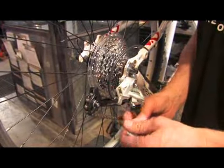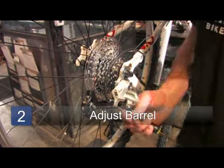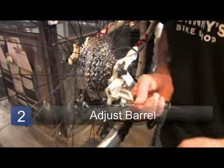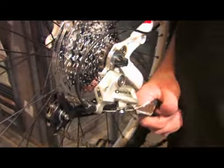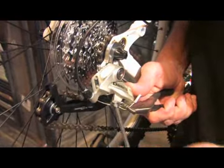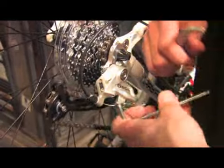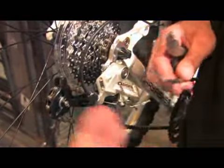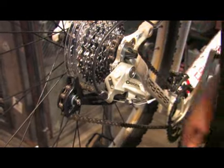Usually, if you start out by loosening the cable, adjust your barrel until you see just a little bit of that barrel right there. You can grab the pliers to get enough force on this cable — you'll want to pull this tight. Tighten that cable down. By adjusting this barrel to that point, you'll actually be able to adjust both before and after. This is for just fine tuning the gears.